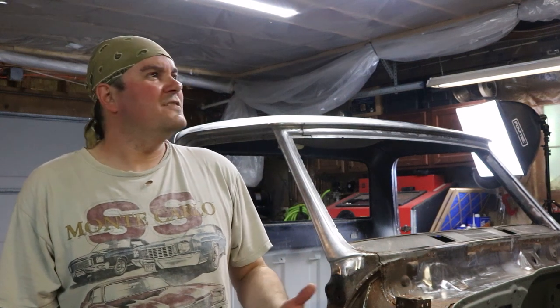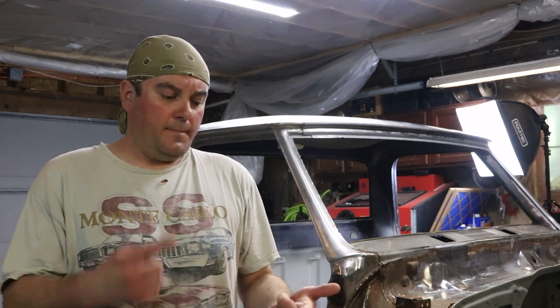We're finally at that point — let's talk about the paint. I told you some cons of using self-etching primer. It's been the industry standard for decades at collision shops because it's very easy to use — you don't need an activator for it. If you're a guy working in his garage, you don't need a paint gun because they come in rattle cans. But there's obviously some — hey Bart, make sure you tell them about epoxy primer!